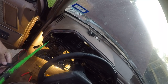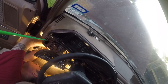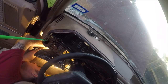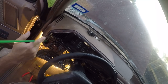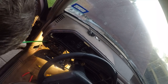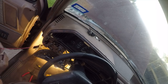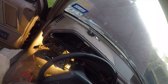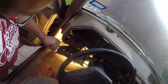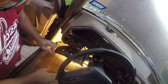This won't be like the other one. There shouldn't be any pressure on it, so I don't need a big piece of tape. Don't need to tie knots. Just tape the wire to the end of the fish stick and pull it through gently. Okay, so we don't need a ton of wire here, but we're gonna leave a few inches to play with.